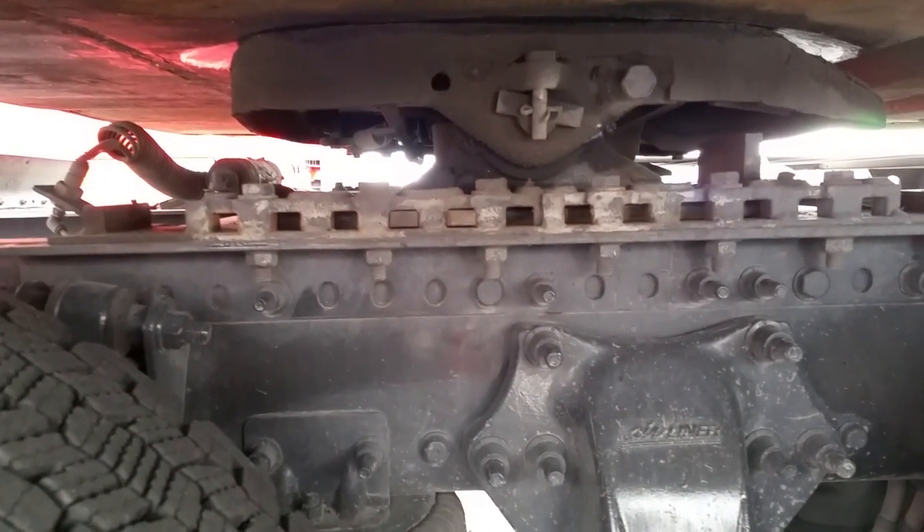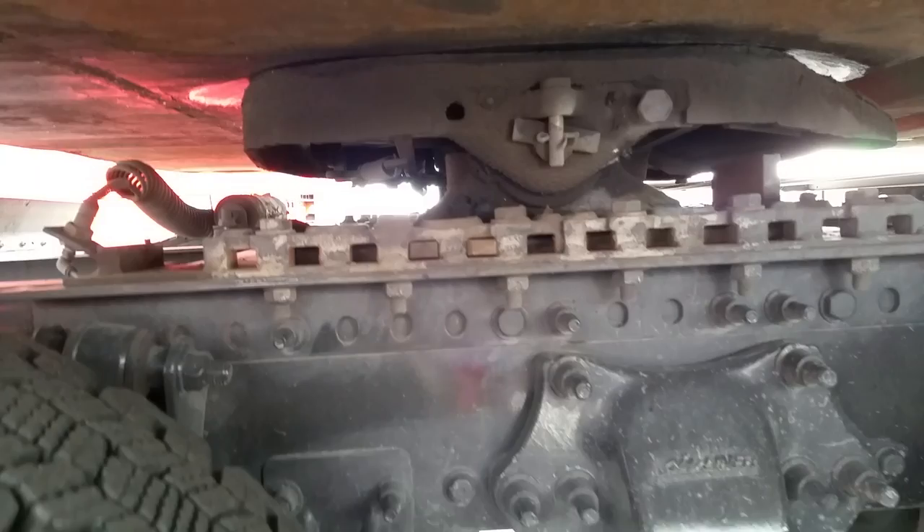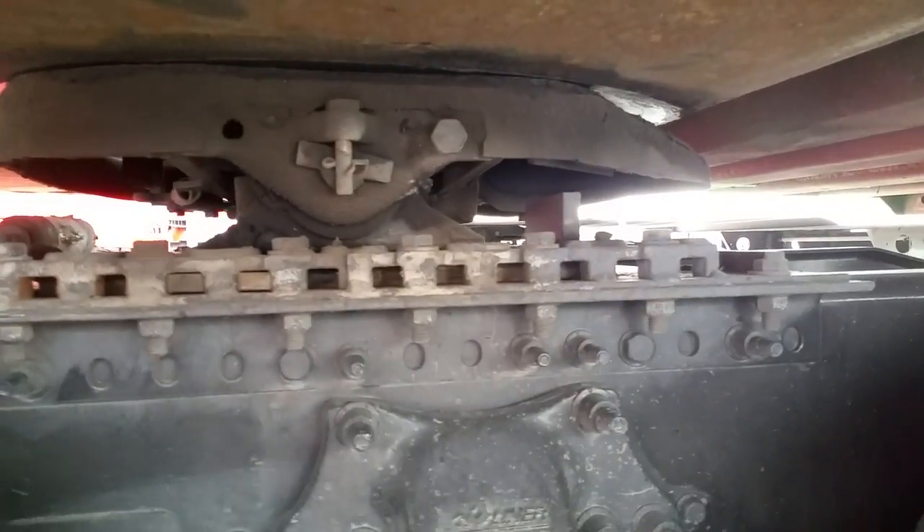Slide just a little bit, engage the lock, then either back up or pull forward — whichever makes you more comfortable — until you hear the click. Get out and check. If you can, mark or rub a spot so you know which holes you moved from and to. Then let the air back in, raise your landing gear, and go re-weigh. Once your steers come back at eleven-nine or whatever, you can fine-tune the weight using just the tandem bar.